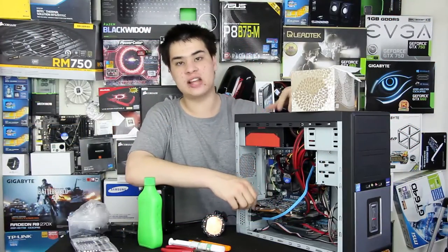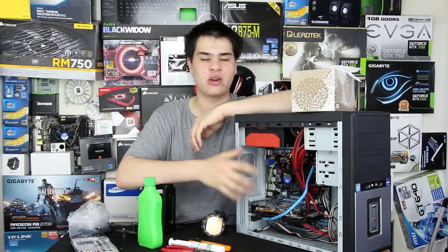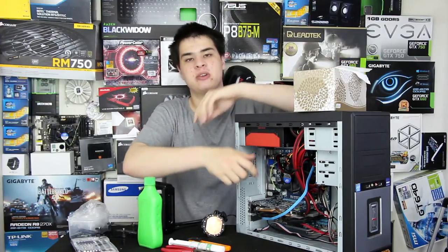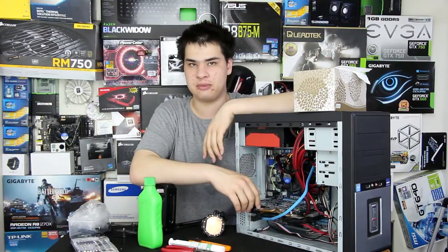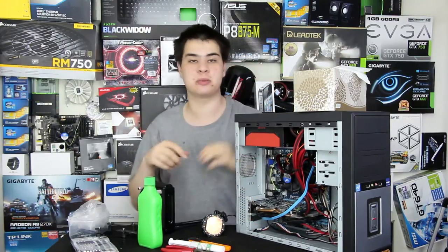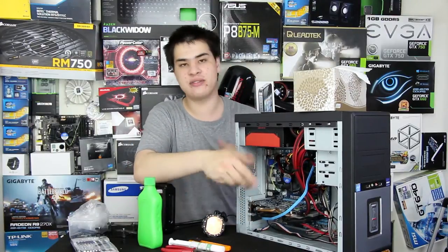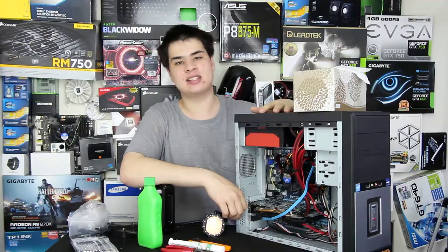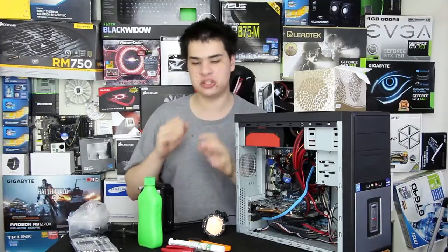It's not the most optimized case, but we'll show you how to handle water cooling in this situation since there's no actual 120mm mount anywhere on it. Lots of people suggest cutting holes in the top or side panel, but I don't really like doing that. We'll show how to mount it within the case and still get decent temperatures. I'd also recommend investing in a better case with better airflow optimization before buying a better cooler.